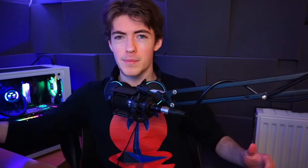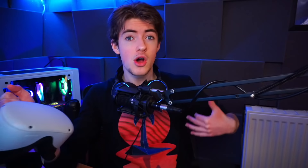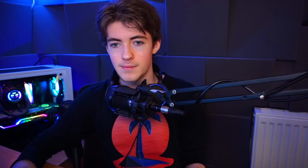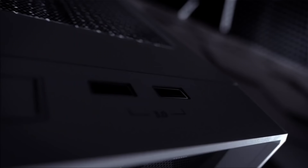Now, in order to actually utilize the speeds that these cables grant you, the next crucial tip before you even start plugging in your Quest 2 and playing PC VR games through Link is to change your USB power management settings within Windows. It blows my mind how many people don't consider doing this or have no idea it's something they should do. To start, go to Device Manager, find your USB serial bus controllers, and make sure your drivers are updated. This is a basic step everyone should be doing, but once your USB drivers are confirmed up to date, we want to change USB power settings so that the Quest and the link cable is allowed full power.